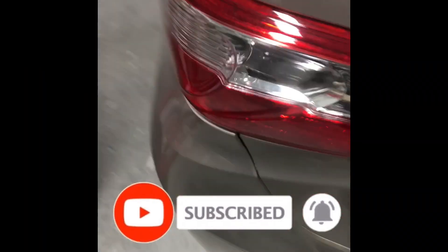Once you've done that, come along here to the side of the bumper right along here and there's gonna be a 10 millimeter screw — it's hard to see, it's kind of hiding, but you can see it's silver right there. Go ahead and remove that as well.